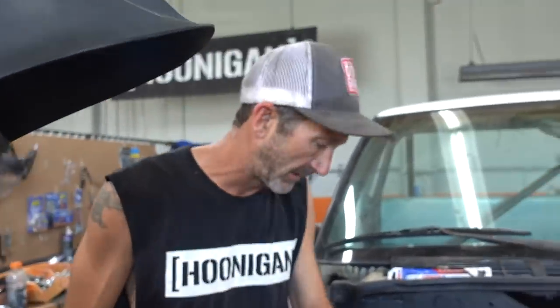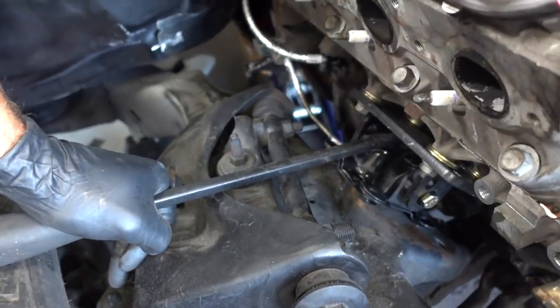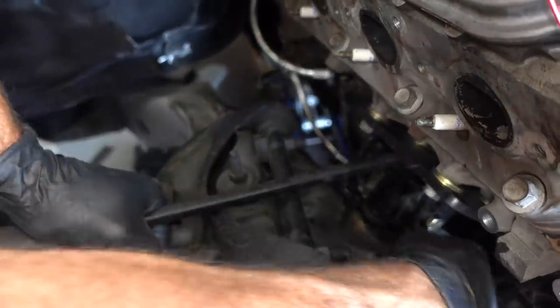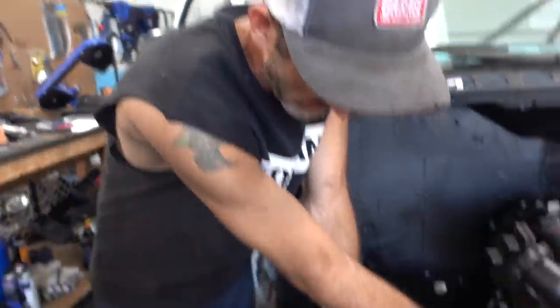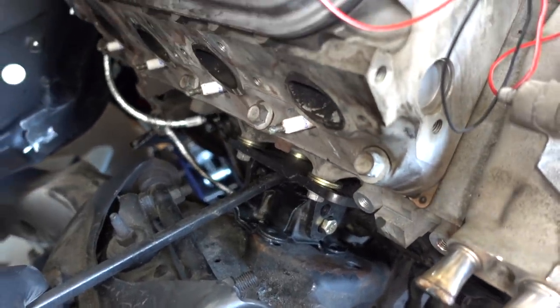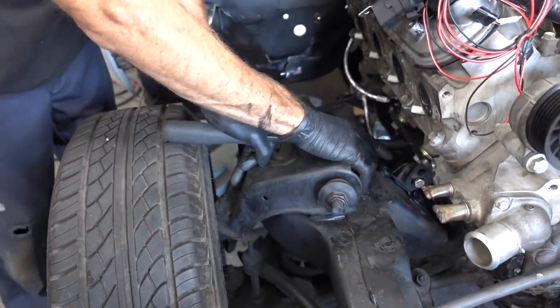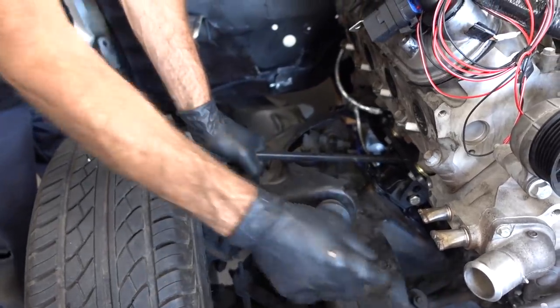There's no engineering in this — the chip don't fit, so we're gonna weld it in. Right now the motor mounts are just a little bit off, and instead of trying to re-drill the holes down here, we're gonna weld this. I already had planned on chaining these motors down because these rubber motor mounts don't like a big hit when you let go of the trans brake. It likes to be solid mounted. We're gonna put a piece of chain from here to the frame so that when the motor actually twists, it'll pull on this chain and won't pull on the mounts themselves.